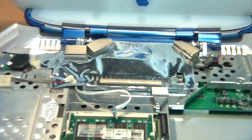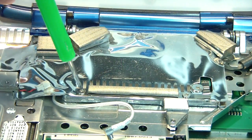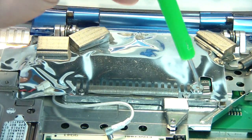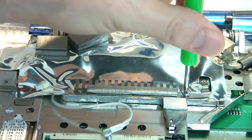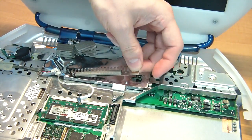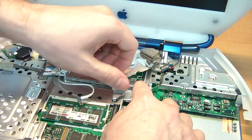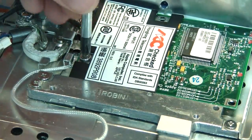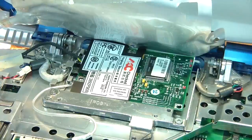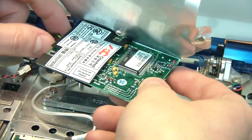Now it's time to remove the modem. Start by removing these five screws. Once you get the three bottom ones off, you can remove the little strip. Then carefully peel up the foil cover to expose the modem. You'll need to remove the single screw holding the modem card in place. Then you can pop the card out and pull the little cable on the left side.